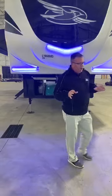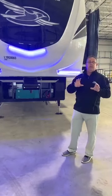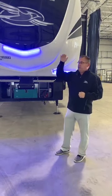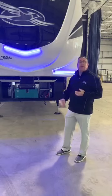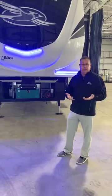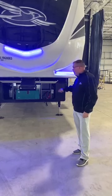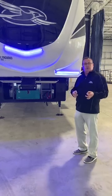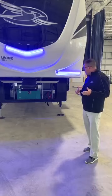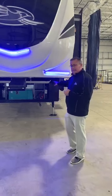When we're talking solar, some people get scared because it's fear of the unknown. The easiest way to explain it: you have fuel and a gas tank. The sun is going to be your fuel, and the batteries — however many you have — are going to be your fuel tank. So if you don't have enough battery but you have plenty of sun, you're only as good as your fuel tank allows. We started this five years ago with a split battery tray, so we can give you room for up to four to six batteries depending on whether they're group 24, group 27, or six-volt. We do that in all of our luxury fifth wheels — Seismic, North Point, and Pinnacle all have that feature.